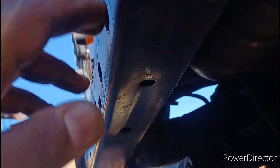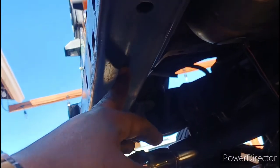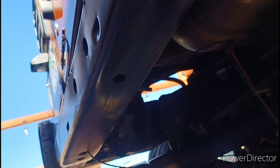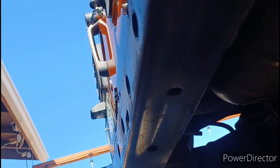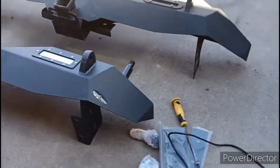There's a long crease right here - that's actually the back piece of the subframe, like a cross member. The hitch has a little lip on it and it just tweaked down a little bit, making a crease. If I had to get it fixed, they'd probably get me a new one - all you have to do is weld it around the edge here, or cut a small section out and reweld the cross member right there. But I don't know if I'll let them tear my Jeep up just for that - I'll survive.